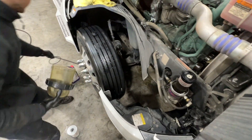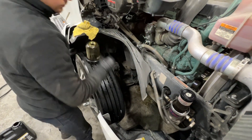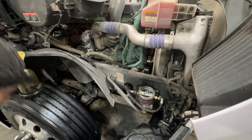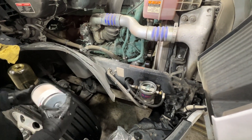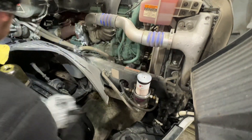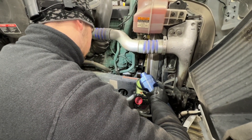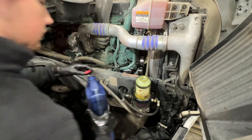You want to make sure the old ring is out. Inspect and make sure there's no water or dirt on there. For these Volvo trucks, you want to make sure the filter is 25 microns — that is very important. A lot of people don't think that matters, but it does. You don't want to be changing these filters out on the road. You want just enough fuel in the system. If you start the truck without adding fuel, air will get into the system and the truck will have a hard time running.